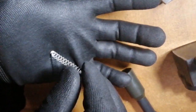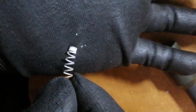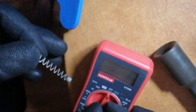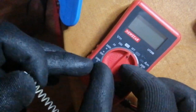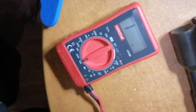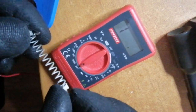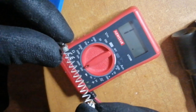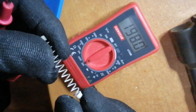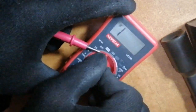We'll try to remove the white substance that sticks on the spring, especially in both ends. So we'll try to measure the resistance. This is basically wire, and the resistance should be 0. So I'm using the lowest range setting in my meter. By just tapping on both ends, I don't see any, it's like open. And I could see around 1 ohm by trying to push the leads against the tip of the springs. So that's not right, so we'll clean it